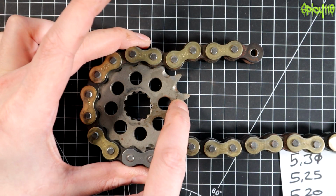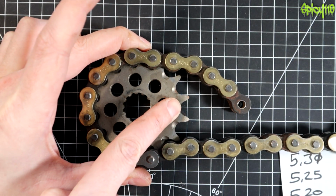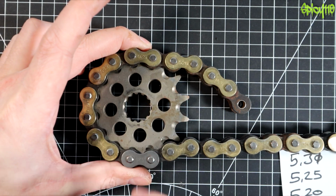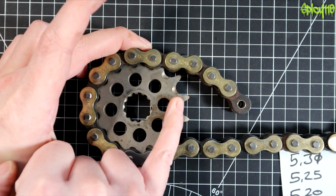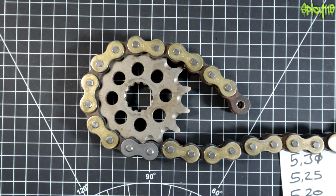Obviously, once these are looking more grooved out, like these actually are, they shouldn't be this wide, really. You have to replace them. If you're getting to the point you're getting waved over teeth or missing teeth, you're really, really not taking things seriously. And the place you tend to see that is on 125s, if I'm honest.